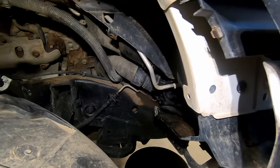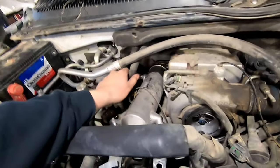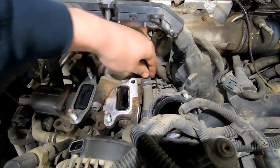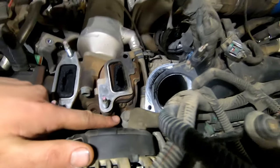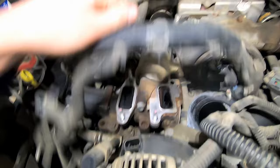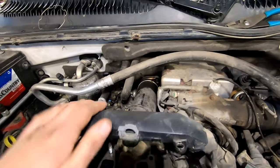To make for a faster removal, I just cut the coolant hose that goes to the EGR cooler at the back with an exacto knife, and same with the hose right up at the front. It's really hard to get these hoses off intact, so just cut them since we're going to be running a new coolant line through there anyway. There are a couple of bolts here — one has a tab that's a bracket for a coolant line, so I like to bend that bracket up after to get it out of the way.